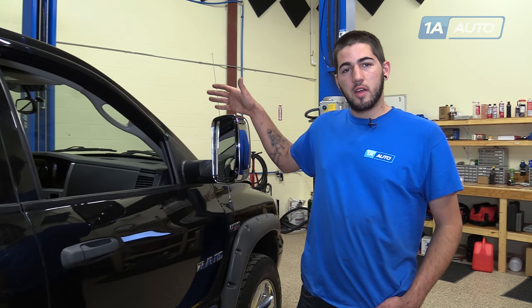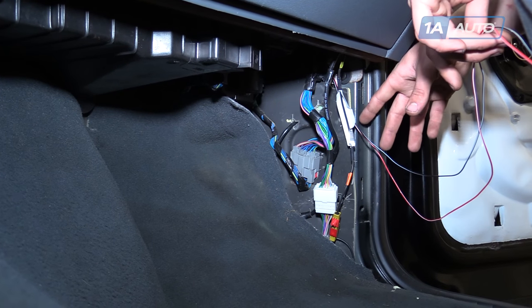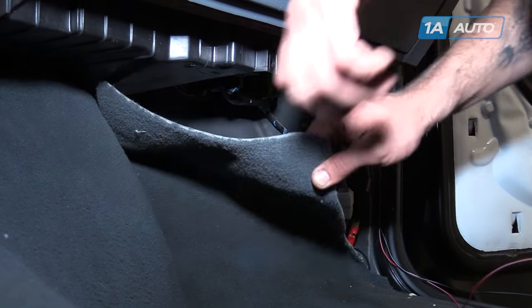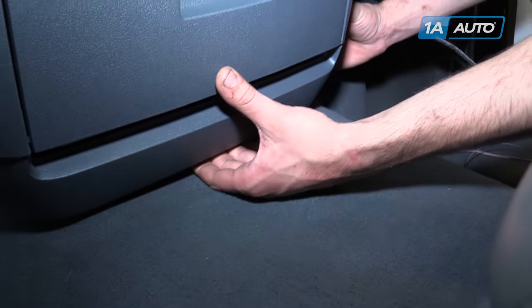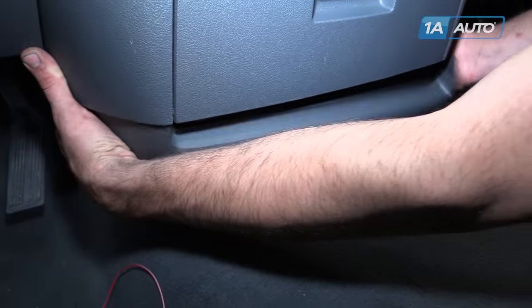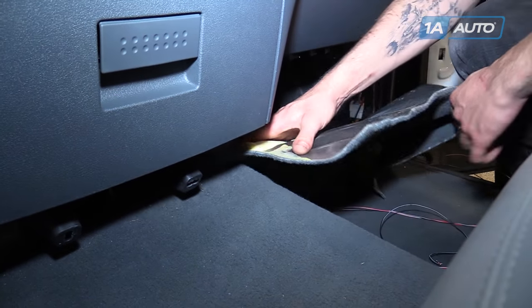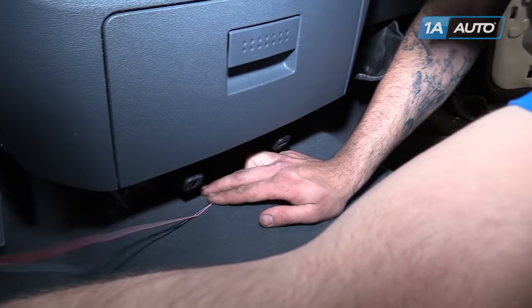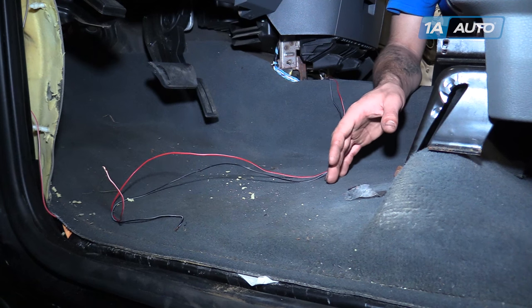Now that you have your mirror installed on the driver's side, repeat these steps on the passenger side up until the wiring goes through the cab. Once the wiring's been run from the inside of the door through into the passenger compartment, peel your carpet up and remove this lower panel below the cup holder simply by prying it out. Placing it to the side, peel your carpet up and route your wires underneath. You can see that our wires aren't going to be quite long enough, so we'll use scraps from our old harness to extend these.